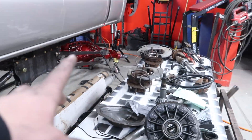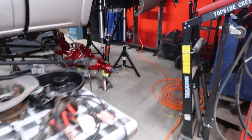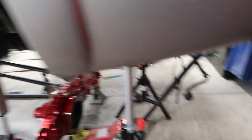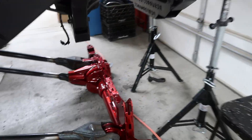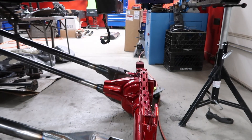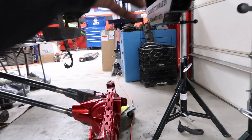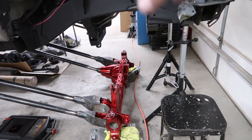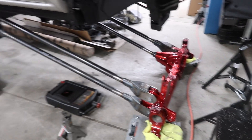We have the front and rear axle set under the truck after pushing in those bushings. The back is set up on jack stands with the shocks — not the springs. In the truck we need to get some measurements and finish some last stuff, but it is all in there. Man, do these look good. Basically what we're doing today: I'm going to jack this up, put the coilovers in and make sure they all fit. We need to make our panhard bars for both front and rear, and also make our steering. I'll get this jacked up, set on some jack stands, and then make some steering. We'll start planning out the steering, get the knuckles on, and see what we can make happen.